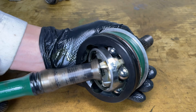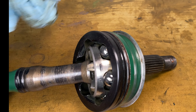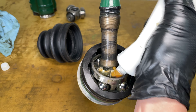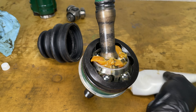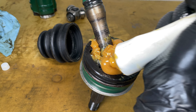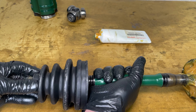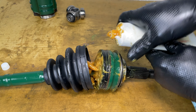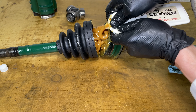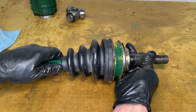Let's take a moment to appreciate just how good this CV joint is. This thing is in excellent condition — this is 24 years old. There's no scuffing on those bearings, no noticeable wear. This is a really good part. Now take the smaller tube of grease and force as much grease as you can into the bearings. I want to completely fill the bearing cup and retainer, so I'm going to push it down with my fingers and move the axle at different angles to get the grease in. Next, wipe a little bit of grease onto the outer boot to make installation easier. Squeeze the rest of the grease into the CV boot — I want to get all of it out of that tube. Now just slide the boot over all the grease and snap the big side in place then the small side.